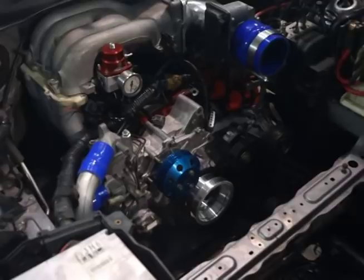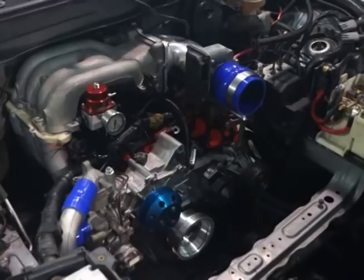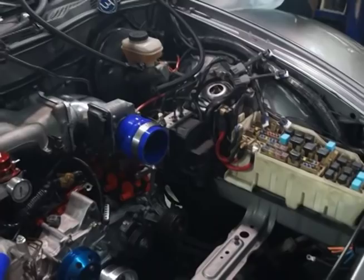Reassembling, because we made doubles of everything so that we didn't get stuck with all the original parts in the prototype car. That's the last thing being delayed right now. The fuel system is getting connected, and the last original parts are getting put back on. We have to make a return line. Create a real fuel system, with pumps on both sides. So you have feed, return, regulator.